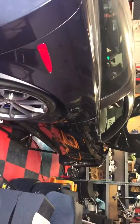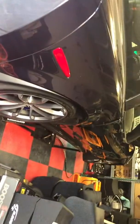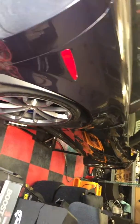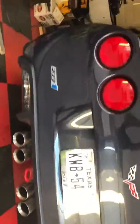Anyway, car's looking okay. I tried to do some leveling. I do notice that these coilovers hardly have any droop at all on the wheels, and that'll help a bunch when I get it on and off of this thing, because that was one of my big problems. I couldn't get my little wheel supports under the wheels because the tires on with the stock leaf would sag so bad. So anyway, everything's all looking good there. All back together. Pretty soon she'll be out on the road.